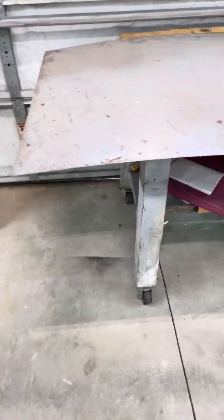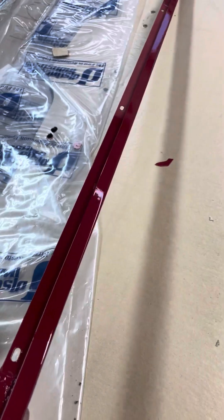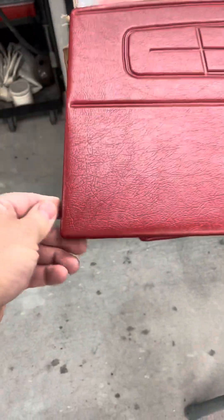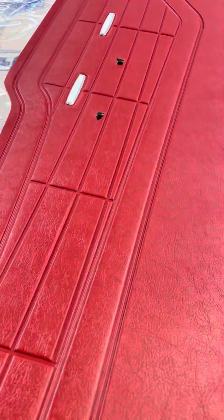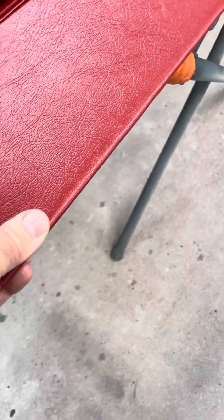What's up? What you got going on today? What's that piece of metal for? What's these door panels for? What's this trim for? This is the original piece of trim that I cleaned up and painted last week, but the thickness of the bottom of these brand new door panels will not work — it's too thick. You can see how thick it is. When you try to press that end, it screws to the door and this panel sits down inside it. When it is so tight, it's wanting to bunch up the material and make it wrinkle, and it still don't fit all the way down inside. You can see how narrow it is.